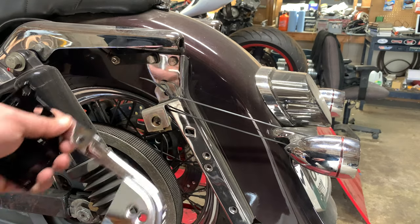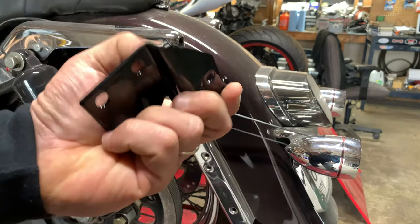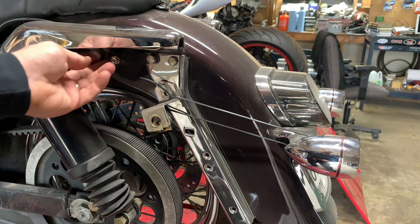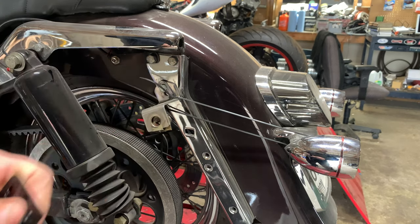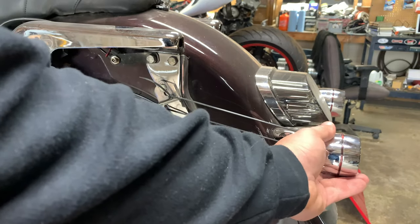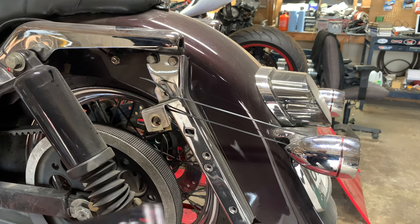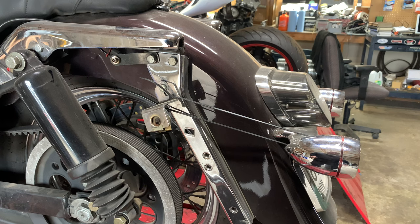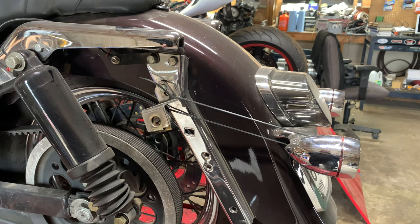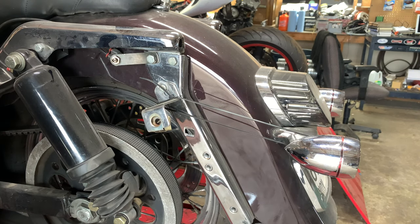This kit also comes with adapters that the quick release sets on, and a bracket with rear and front holes for your air gauge. This bike only has the rear, so we'll be putting it in the rear hole. You can see there are zip ties here because he lost a bolt in his light, so we'll be putting in a new bolt as well. I'm going to try to follow those instructions as best I can, but they're hard to understand and don't give a lot of pictures or step-by-steps. Step one: remove the bags. We did that. Success.